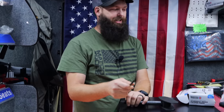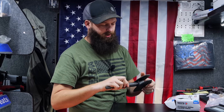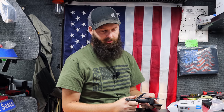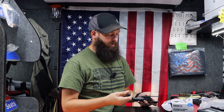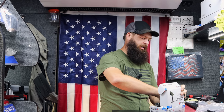Somebody will shove an impact on it and go to town. Well, as long as you can control yourself with it — there's a couple of reasons you don't want to do that. For one, you don't want to mess the tool up, but also you don't want to try to push that fluid back too fast and mess something up in the caliper. I've seen people with seized calipers try to use ball joint presses and stuff, and it usually turns out bad. I mean, if they're already stuck, something's already wrong. You can put a 14 millimeter on there, use a ratchet, run it down. Like I said, if you can control yourself with your impact, probably so — just not wide open all the way. Let me look it up and see what an average price on it runs.